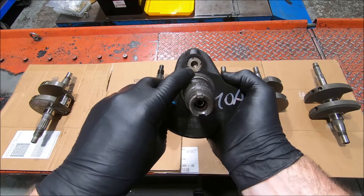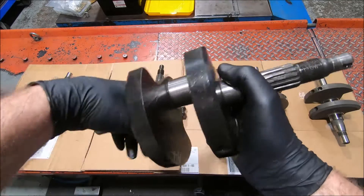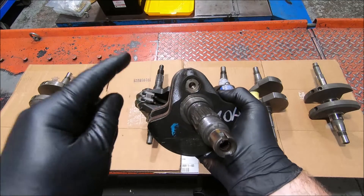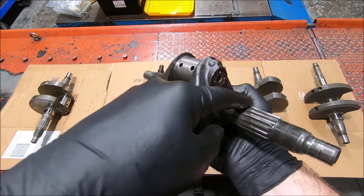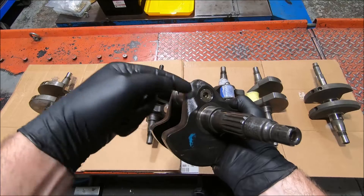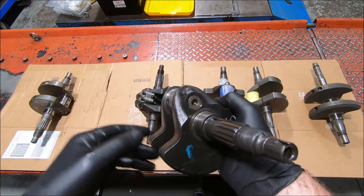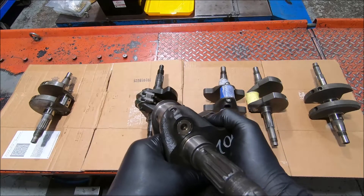The big end plug is staked in at the factory - this one hasn't moved. This is a 999 that had a lot of main bearing material go through everywhere - it's a mess. In the later 999s, and on the 1000 engines and the 749Rs, they did away with the sludge trap style big end. Those cranks have a hole straight through, and to oil the big ends, starter clutch, and down to the bearing, they have drillings through the crank that are plugged and drilled through into the main journal. I've seen 2005 999 cranks that have that big through hole. The 1000 SS and all the 1000 DS engines have that, which is a really great way to get rid of the big end plug issue like on the ST2.